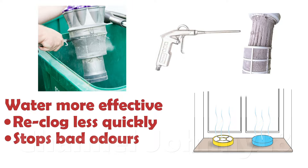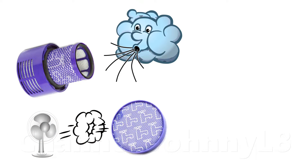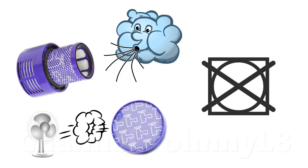It's also not possible to clean a fine HEPA filter by blowing because they work very differently. Rinsing is a very quick process that's at least as quick as using compressed air, and drying time can be sped up using a cool fan if necessary to ventilate, or leaving near a warm radiator. Filters should never be put in the tumble dryer because that can damage them.